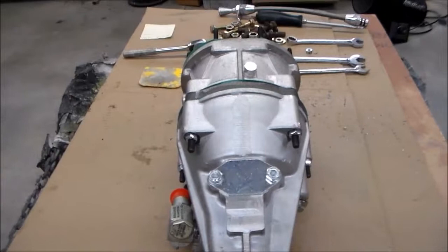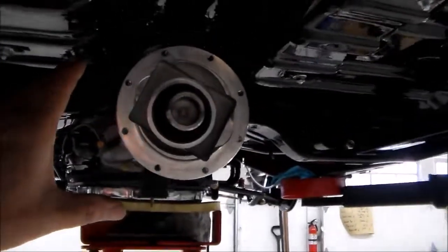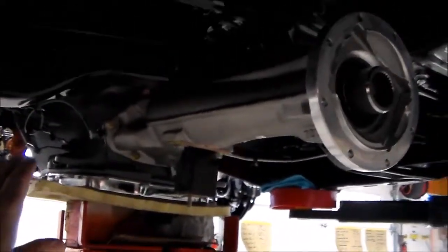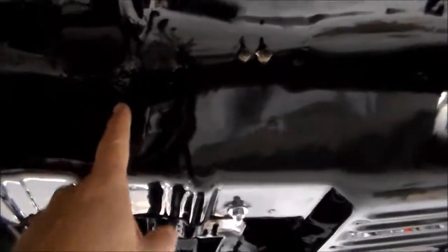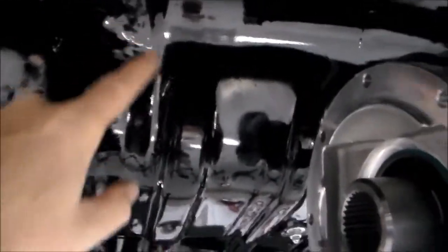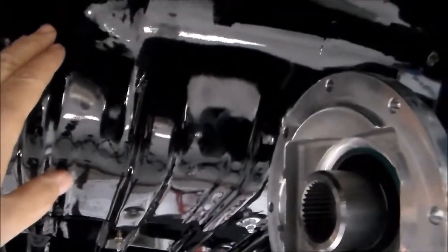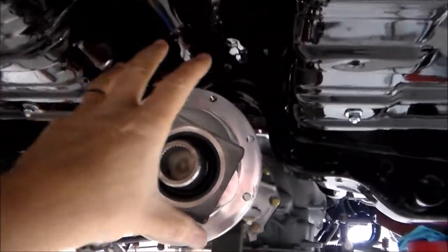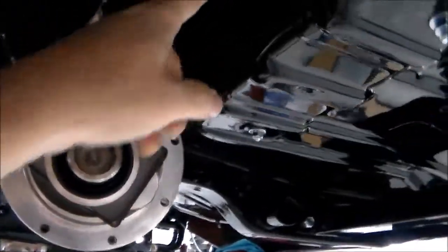Those two corners really don't like the floor because I want this unit to sit way up, tucked away. Here's the back of my transmission and engine in the car now. If you look up here, I've got a little bit of a dent here and another little bit of a dent over in this area. I laid masking tape down and just tapped it to give myself some clearance. I'm going to take the gear vendors unit, bolt it on the back, raise it up, and then you'll be able to see what I'm talking about.